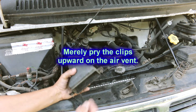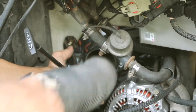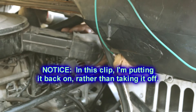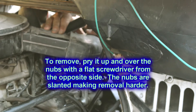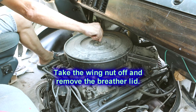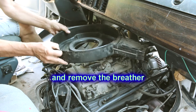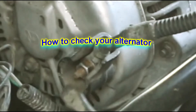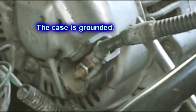I had to remove this air vent — it's got these little clips, you just pry them out of the little holes. Now with the doghouse off the engine, I'm pointing with the screwdriver — this is where the power comes out of the alternator when the engine is running. We know that this case is grounded to the battery ground because we already checked that.